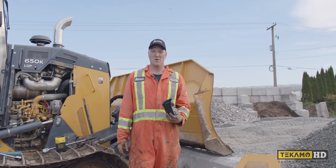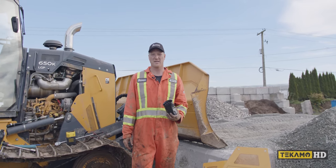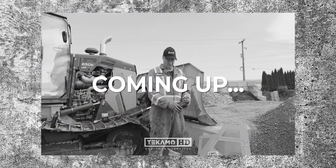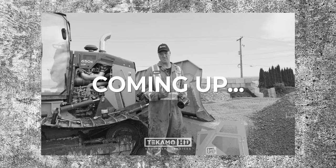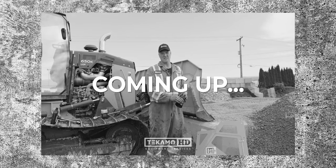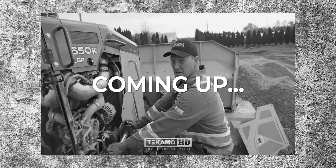Hi, I'm Keith and I'm going to show you why you do not use a tool to tighten up a spin-on oil filter. This filter is completely crushed from me trying to take it apart. In this case I managed to get it off with my strap wrench, but there's no need for it to be that tight, as you saw when I tried to pull it off.